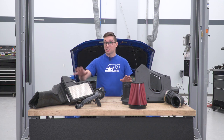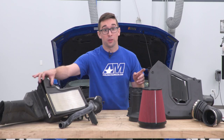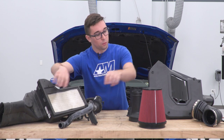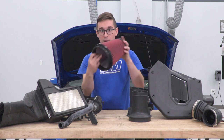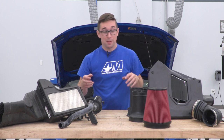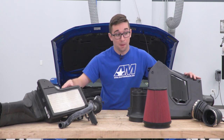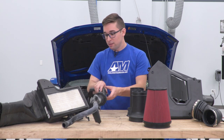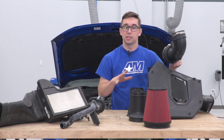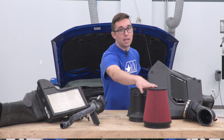Here on the table, we have the stock intake versus the new Roush intake, and there are a few key differences. First and foremost are the air filters — the stock one comes with a smaller panel-type paper filter, while the Roush has a nice mesh dual-layer cone-shaped filter with a lot more surface area so you get a lot more air through it. The air box itself on the Roush is much bigger than the original. We're also losing the big sound tube and the little resonator box — the Roush setup is simpler, a bigger box that allows more air in through both the box and the filter.